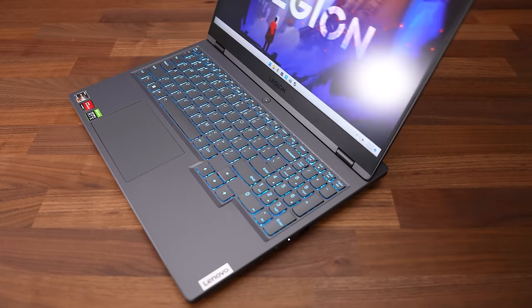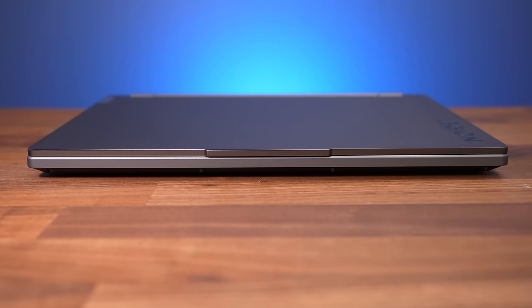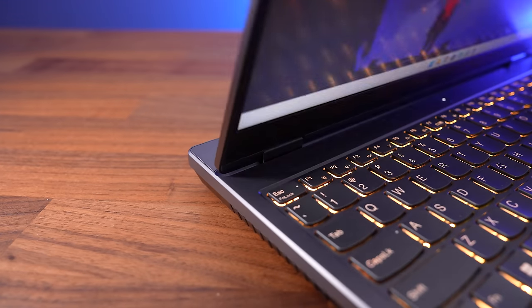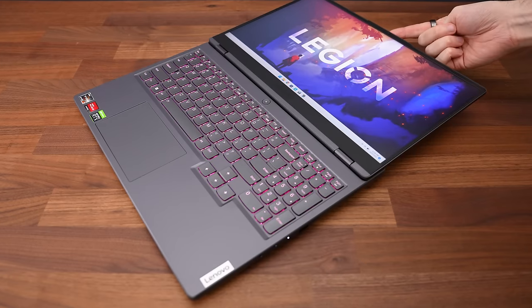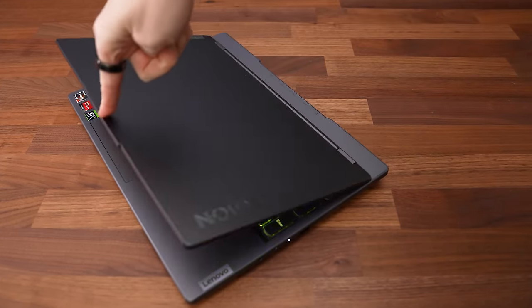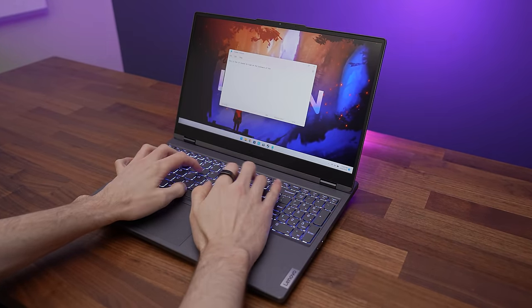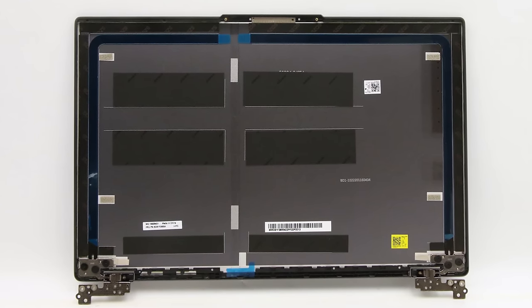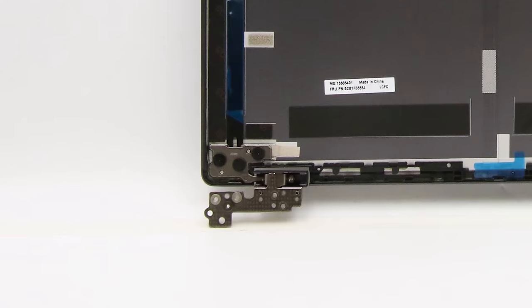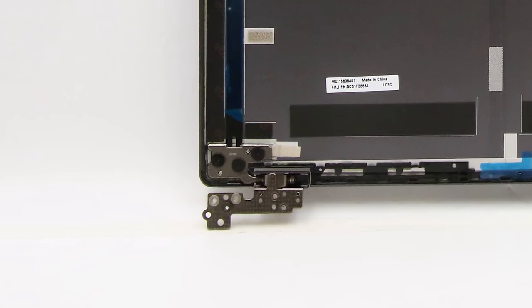The screen goes the full way back for sharing, and it was easy to open with one finger as the middle part of the lid sticks out a little. The hinge seems sturdy even when ripping it open hard, but despite this the lid still feels easy and smooth to open, though the screen can wobble a little when typing hard. A photo from Lenovo's parts list site shows that the hinges are connected to the panel in multiple locations, so it's probably fine just like last gen, but only time will tell with long term use.